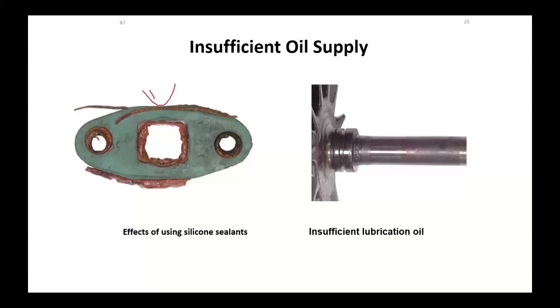This is not the way to securely hold a gasket in place while you're putting the turbocharger in. If you're going to do anything, put a little grease on this thing, a little spray gasket material. That chunk is going to break off and wind up getting into the turbo. It's going to block the oil return or the oil flow. You're going to wipe out that impeller shaft.